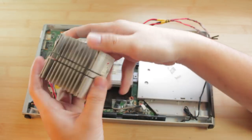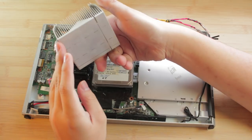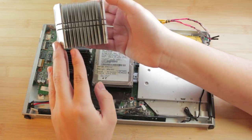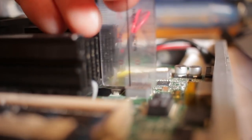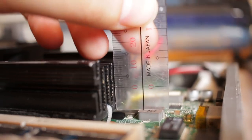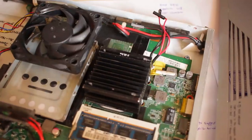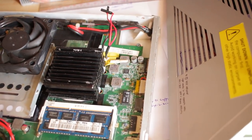I'm really gonna try cramming this AM2 heatsink on it, which is a much, much bigger cooler. So really, this is all I'm worrying about. That's why I want to cut the heatsink. This height clearance to these chokes is 1.5 millimeters as well. I think I could even just not cut the heatsink at all.